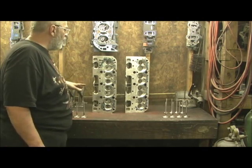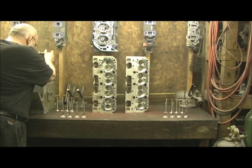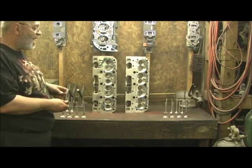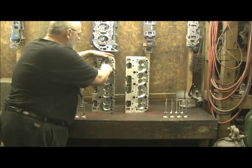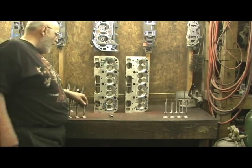I'm going to show you real quick the first thing I do, which is I usually take a chamfer tool. This is just where you pull the nose on the valve guides and you have to go in there. This is a wedge, and I'll just go in and make a few circles around and trim that out and get it ready to shoot the hone through them.